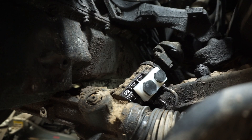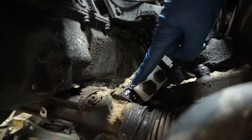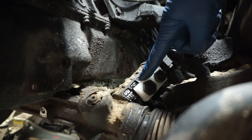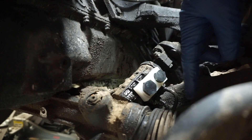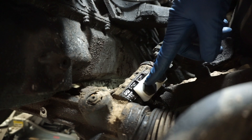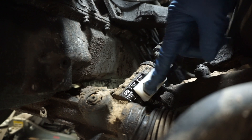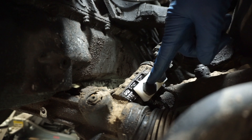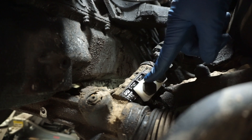Here's the final product. I did get a torque wrench to torque this to 15 foot-pounds, but the bottom, larger bolt never got there — the sides of the delete plate started to get a little squished out. I'm not sure what's going on; it just never got super tight so I stopped. They're not going to come out. I used a torque wrench and never got anywhere near that 15 foot-pound spec, but it did start to squish out a bit right here.